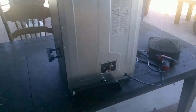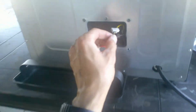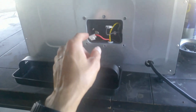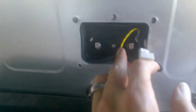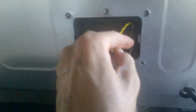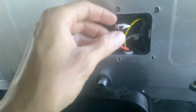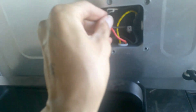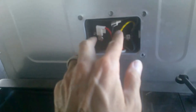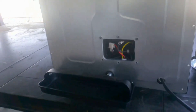The first thing we did was find the element, which is back here behind this cover at the bottom - six screws. You're going to have a red, black, and a yellow-green wire. One side of the element, another side, and ground screwed right here. There was a piece of heat shrink that went around everything; I just took my razor, sliced it off. We're no longer going to use these - we'll tuck them in there and put the new controller on, running it up to a box I made.